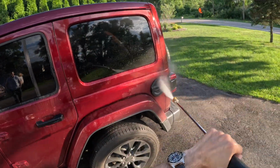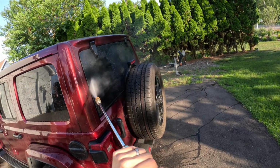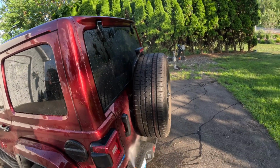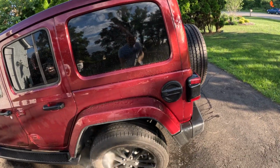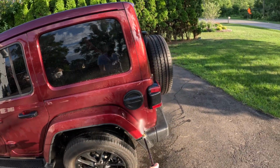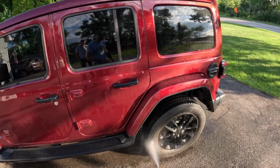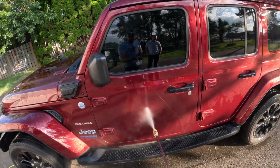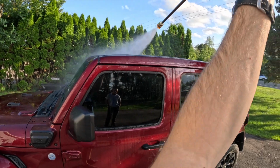This is a really important first step to removing dirt, right? On paint, you have a clear coat that sits on top of a color coat that sits on top of primer, and then the metal. So it's 3 layers and then metal, the body panel beneath that. The thing you always have to watch for is love marks and swirl marks in that clear coat. This is what dulls the finish. This is what makes a car look like it's been scratched on. We're not talking about scratches. Scratches you can physically feel with a fingernail. These are things that look like swirls or are swirls.